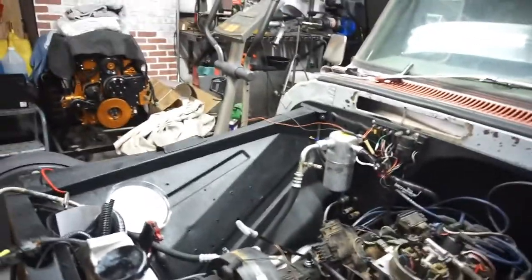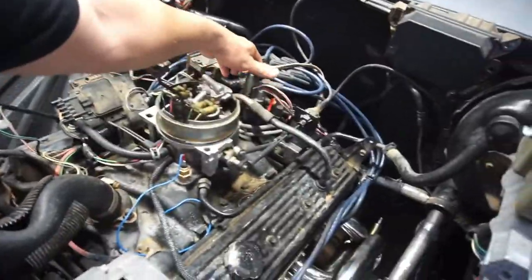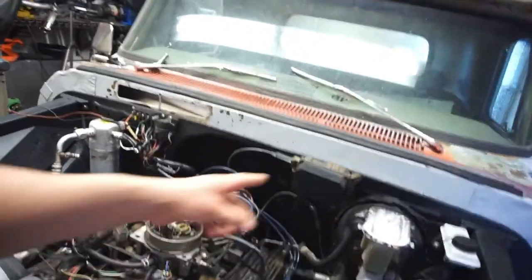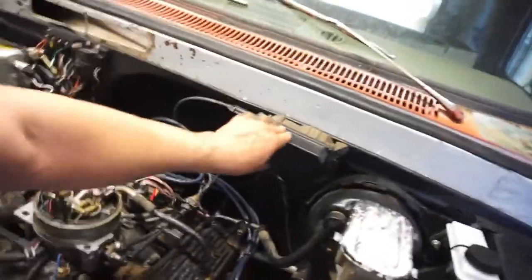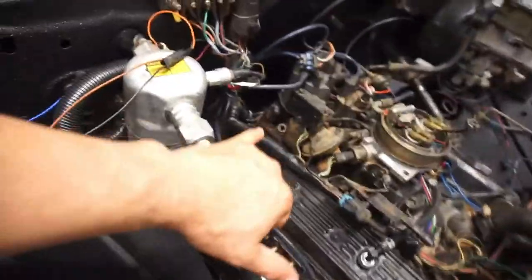This wiring's going to have to go in the cab — that's for the windshield wiper. And the one for cruise control is going to have to come out too. I did mount the cruise control unit right there, so I was making progress. I did find out that the line that went from there to the heater core is broken — the fitting is broken inside there — so I'll have to take an easy out or something and remove it.